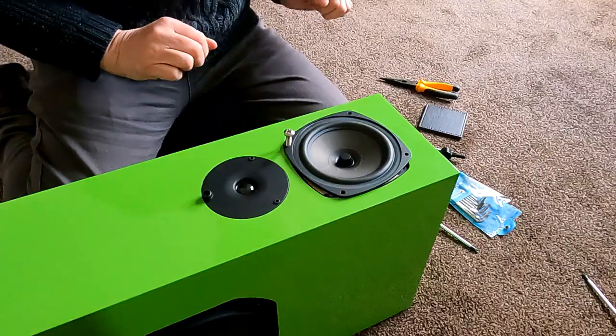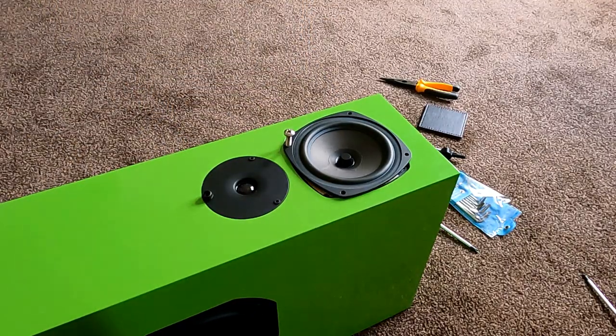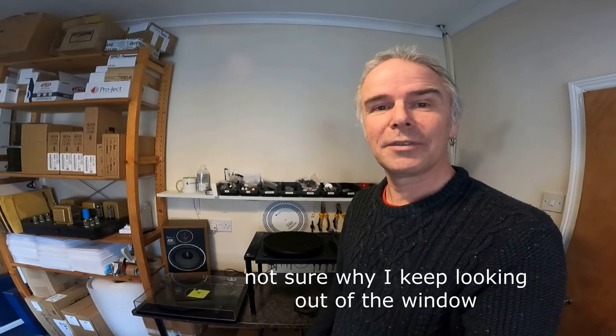So that's how you take the driver out. That method works well — just find a screw that bites into the chassis, and then you can either make up a tool or use pliers if you've got a pair you're not too concerned about. You'll have to use a seesaw effect, so you need something to put under it as a fulcrum. And always protect the cabinet, because you can crack it — there's quite a lot of force involved.